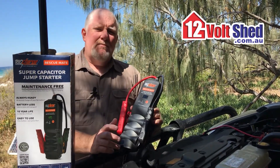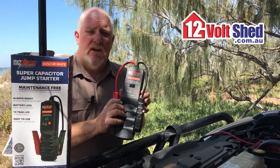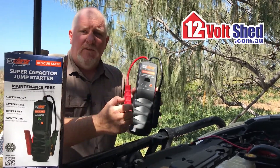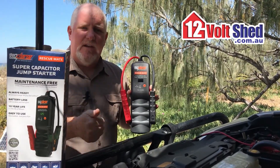I've got a few people who have asked me about 24 volt. Pretty simple — a 24-volt battery is typically two 12-volt batteries joined together. What I personally would do if I had a small truck: connect to the first battery, give it a jump, connect to the second battery, give it a jump, connect back to that first battery and start the vehicle.